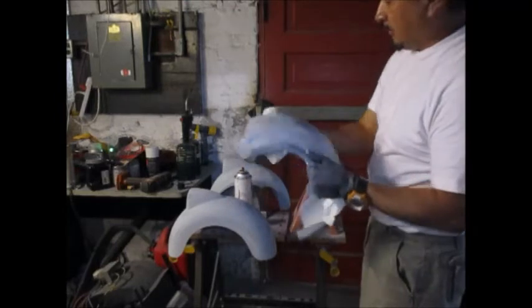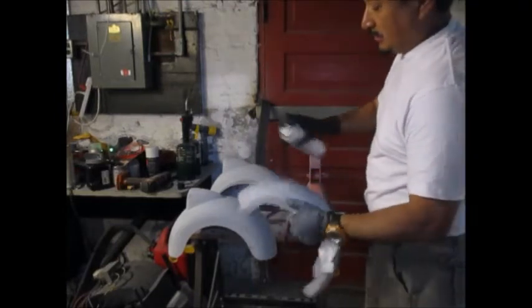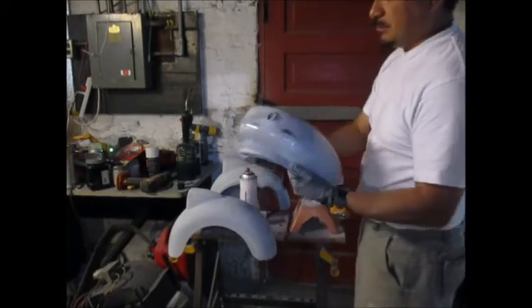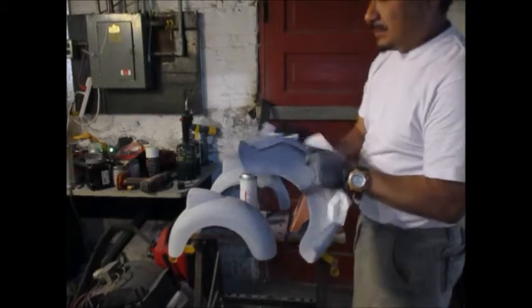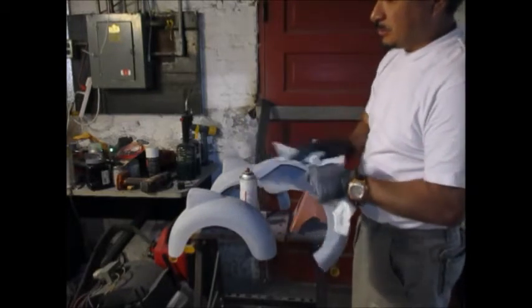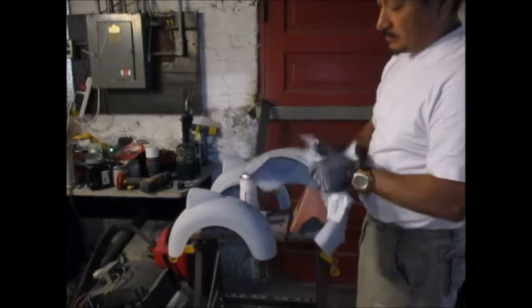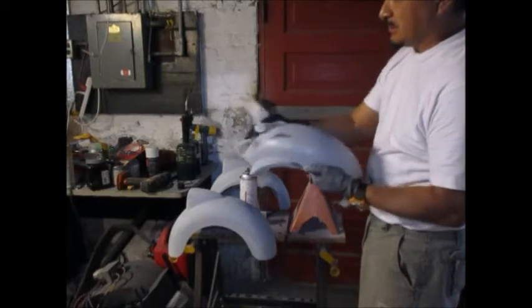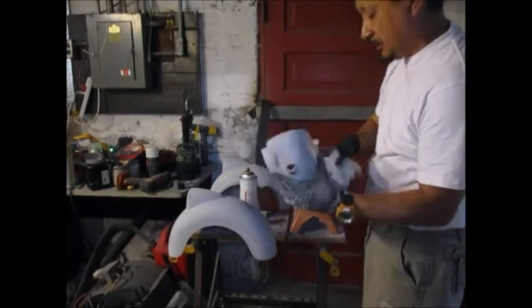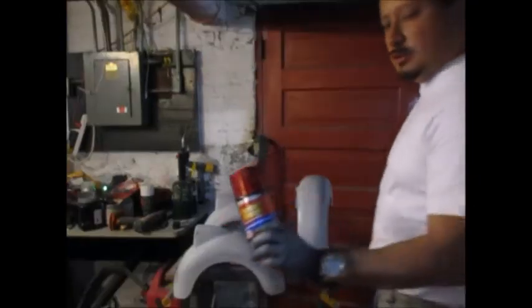I may have done two or three coats of gloss on the last one. The reason I'm shooting gloss on this one is not because I'm going to wet sand it - I don't want to bust through it. It's because this is a kid's car that's going to be outside, so the gloss is actually the sealer, the protector, the UV spray. That's what the gloss is.